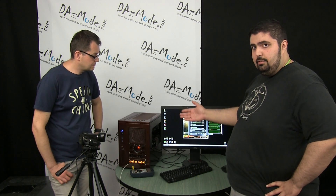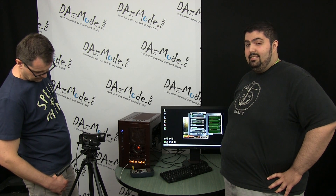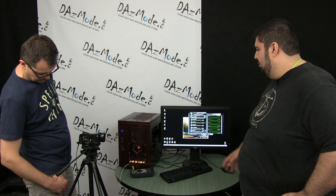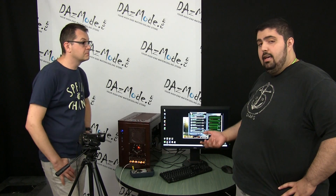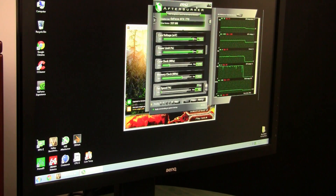Power limiter is a new thing for NVIDIA since the 600 series Kepler cards. You want to always put it at the maximum. What it does is determine the amount of power that goes to the GPU core. So let's say the power limit at 100% is 200 watts — if it tries to go over 200 watts with the limiter at 100%, it'll keep dialing back the voltages and clocks to hit that 200-watt limit. On this card 100% is around 300 watts; on your card it might be 150, 200, or whatever. But setting it to maximum gives you the best possible option and maximizes your headroom.